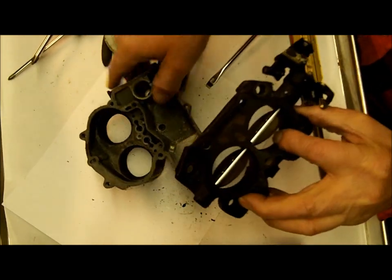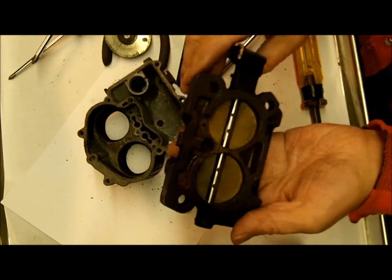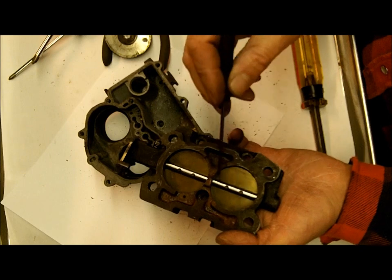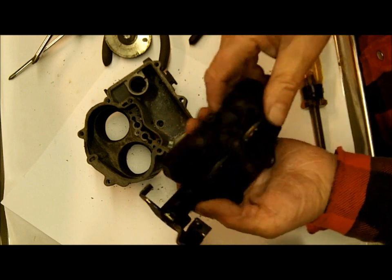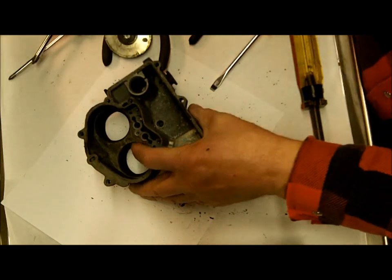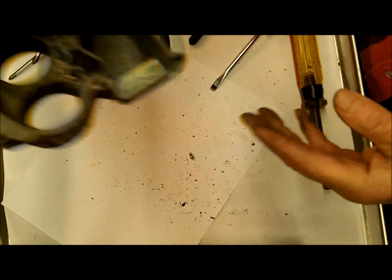So that's the carburetor torn apart. I usually take these apart to get them nice and clean — it's kind of optional for you. Before you do anything, grind these off flat to get rid of the mushroom end or you'll break the screws, then work them out slowly. You hardly ever have to bush a marine — they're always tight because of the nature of how you run the boats. So there you go, it's all apart. I'll throw it in the cleaner and I will do a video on putting it back together. Thank you for watching.